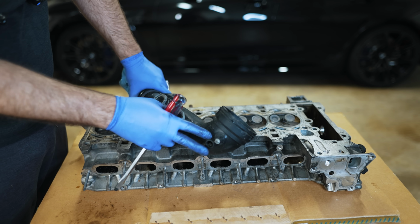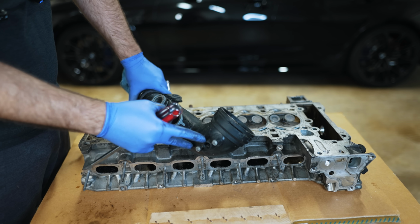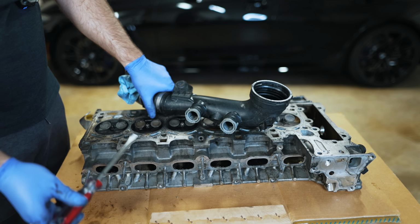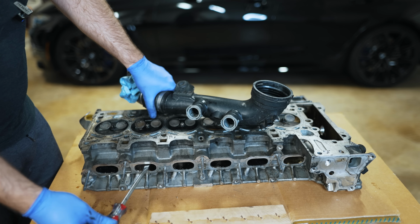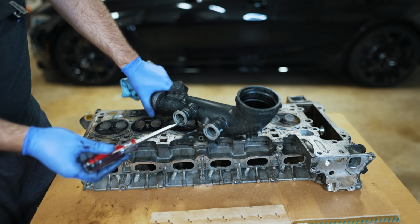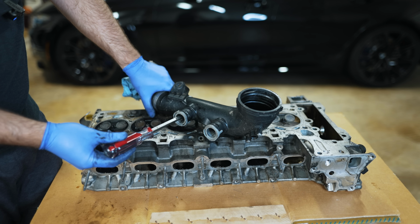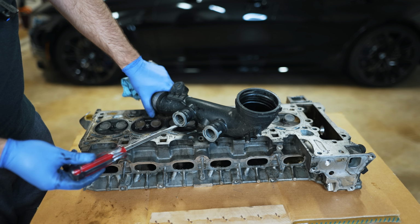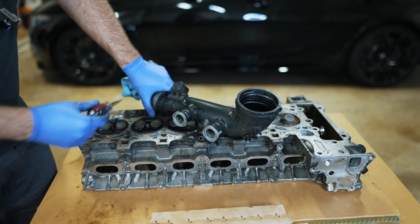It didn't matter as much if you had a MAP sensor, because it was all about what ends up in the manifold in terms of pressure. So I think we're at an advantage because of the way they've tuned these cars to push the excess pressure out the exhaust. You're no longer in a situation where you're going to have a rich condition when you're shifting gears with a mass airflow based turbocharger system, because it's just going to push it out the exhaust anyway.